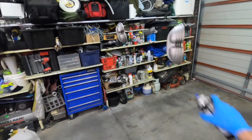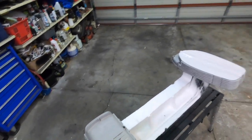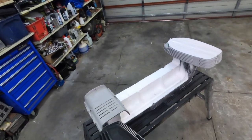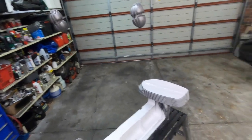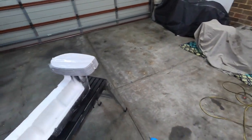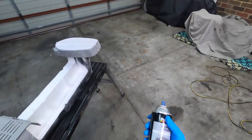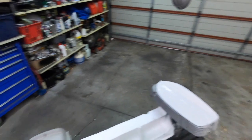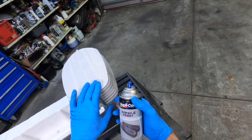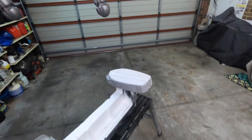So I'm about to do my new valve covers — I've got the little peanut valve covers, the timing case surround, and the top cover. Unfortunately I can't do the front cover; it had a bit of a gash in it so I've had to put some filler in, so that won't be ready until tomorrow. The can says to do 3 wet coats a couple of hours apart, but from what I've googled and what I did yesterday — which worked perfect — is 3 dusting coats about 10 minutes apart. After that you give it a couple more liberal coats and then hit it with a hair dryer to get the wrinkles nice and tight.